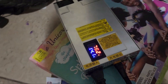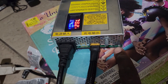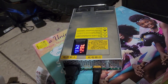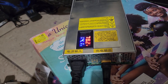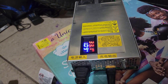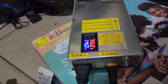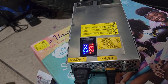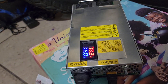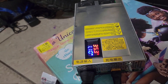Remember: when you're charging your battery you have to set this switch to the left. That's going to activate the auto-stop feature. If you don't have that switch flipped to the left, it is not going to be enabled and you can potentially overcharge your battery. That's the reason why I really don't recommend this to anybody new to the e-bike community and to batteries, because this charger is really potentially dangerous.